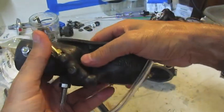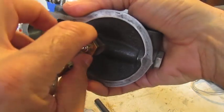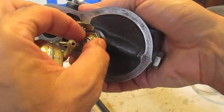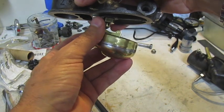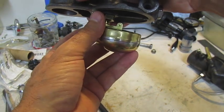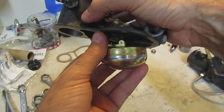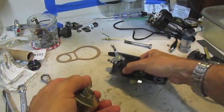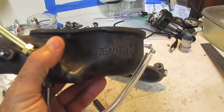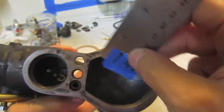To adjust the float level, you're going to adjust the float valve using shims or additional gaskets. When everything is tightened and you're measuring your gas: if the float rises and shuts off the gas when it's too low, you won't have enough gas in the bottom. If the float rises too high before shutting off the gas, you'll have too much gas. You want it right in that five-eighths range — not too much above, not too much below.